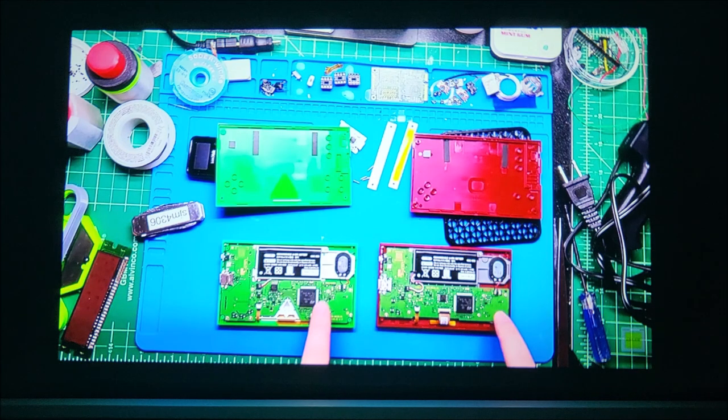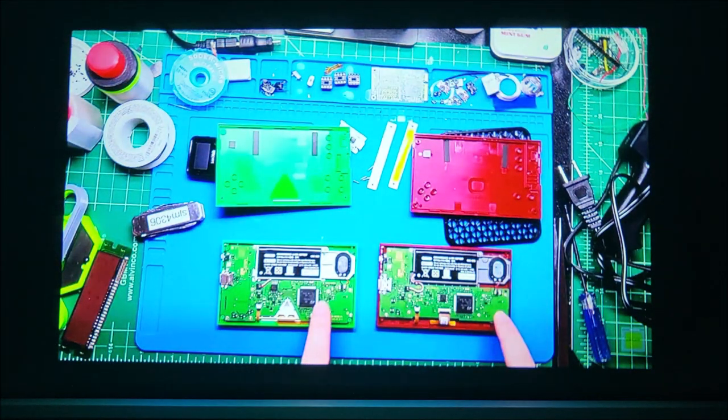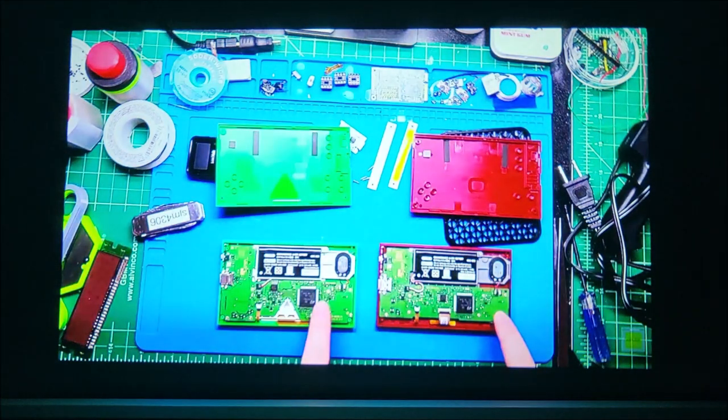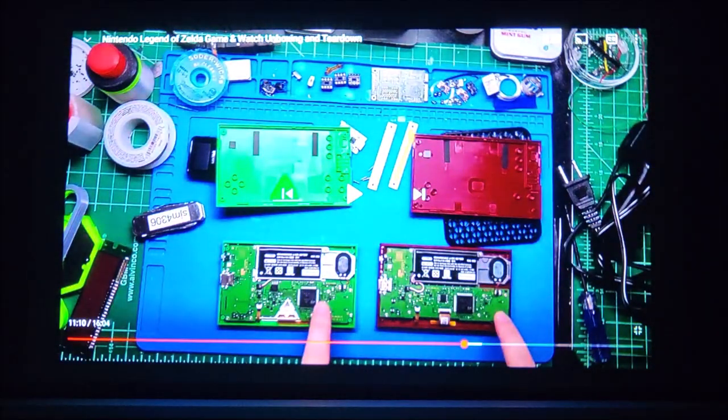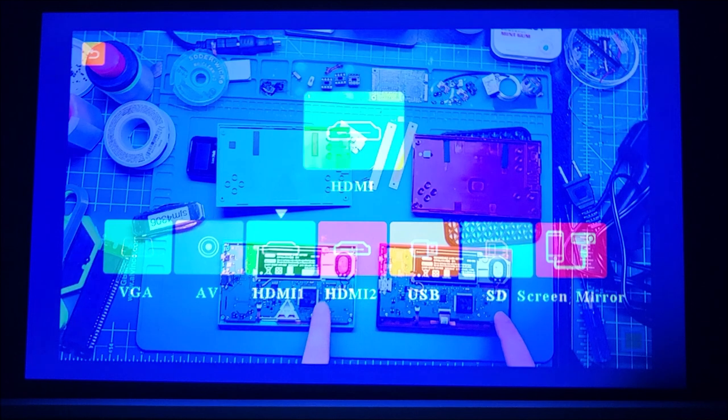Instead of, even this doesn't look, does not look 1080p. This looks maybe borderline 720p to 480p, something like that. And you can even see when I'm bringing up the on-screen menu and not, it's pixelating. So yeah, I think it's just a limitation in general of wireless casting from this tablet to either the internal or the dongle. It's just not so great there, but yeah, like I said, just switch over to HDMI.